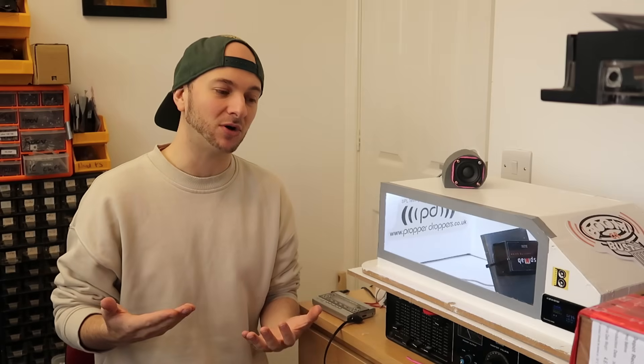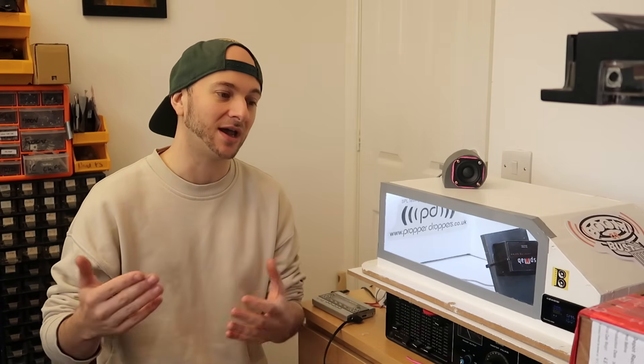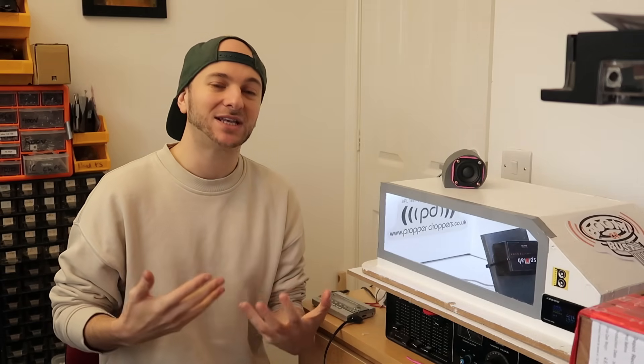Since the start of the series, people have been wondering what a sealed box does in comparison to all the other boxes we've tested so far, for scientific reasons. Naturally, sealed boxes tend to be not quite as loud as many other styles of boxes like bass reflex, transmission line, horn, bandpass, and all the other box designs you might choose to run, but sealed has been the choice of SQ and ease of integration into a system and relatively predictable frequency response and results.